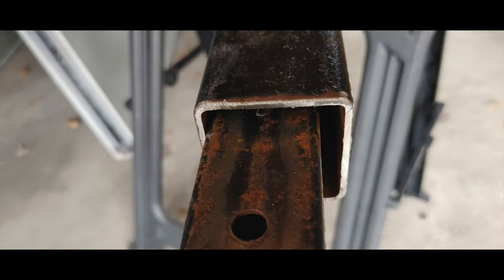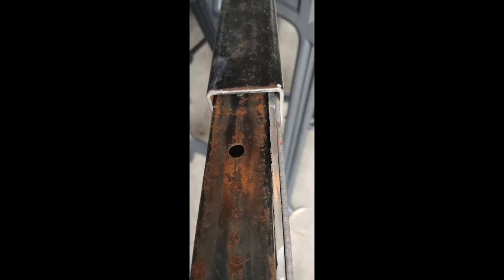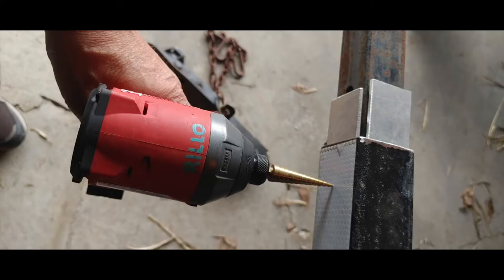You can see that it's about a quarter of an inch smaller in both directions. Here I have some aluminum scrap eighth-inch thick that I cut into strips to use as shims. In this picture you can see how I have the two shims inserted on the side, and there'll be two more on the top. I used green duct tape to hold pieces of the shims at each end so that the inner tube would not be wobbling around as I'm towing it down the road. Then I drilled holes through both sides of the frame, through the shims, and through the inside piece.